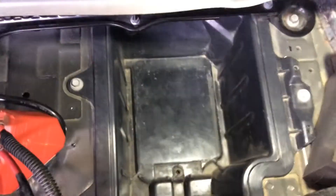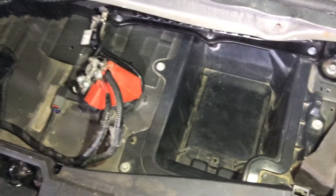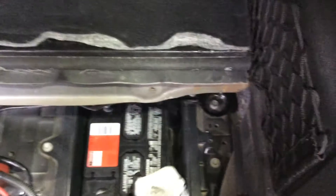You'll have to cover up the holes in the back and the battery tie-down with a little bit of silicone, caulking, or whatever you have, just to keep water and moisture out. Once you complete that, you can put the larger battery in place. There's not much space once you put this battery in — it's not going to roll around, flop around, or hit anything.